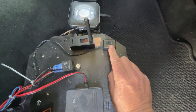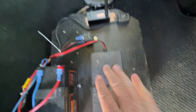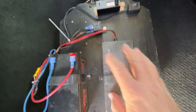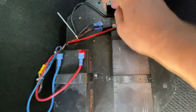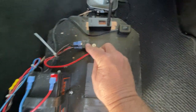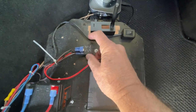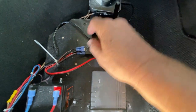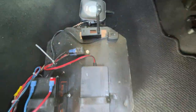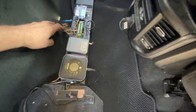When I start the truck up in the morning, I make sure this is off — probably don't need to but I do it anyway. Once the truck's good and going I'll turn that on and the charger will start charging the battery if it deems it needs it. I'll probably replace this relay with a bigger one — it doesn't get very warm but it's not meant for continuous duty. I've found some relays that are bigger and intended for continuous duty. I'm also going to clean up the wires and replace this cheap wire with some real wire.